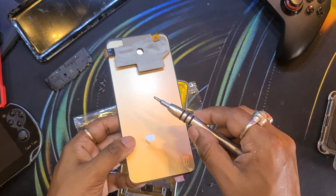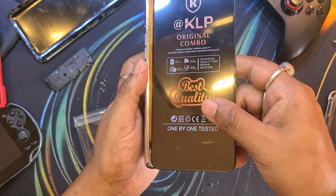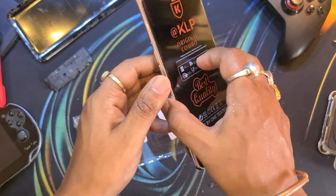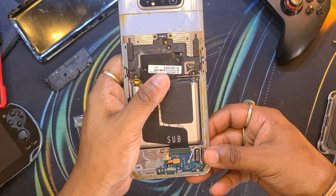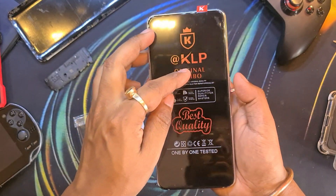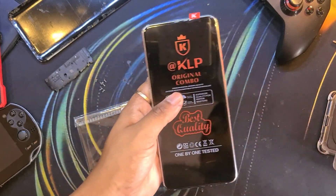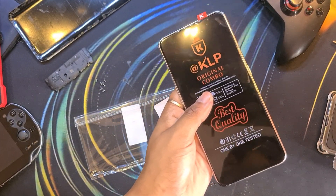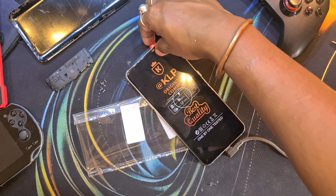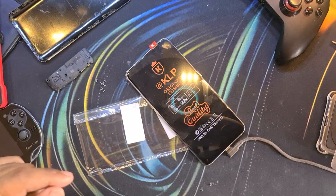For any kind of repair work — be it a display, speaker, back glass, whatever — what I do is test fit the part first, see that it is working and compatible, and then only glue it down. As you can see, I am testing out the display and I have not put glue on yet. Unfortunately I forgot that the phone is out of charge because it was lying around for months. Nonetheless, let's put it to charge. And just like that, you can see we are at 2% charge and the LCD is working. So we can confirm it works and glue it down.